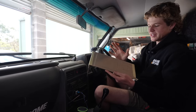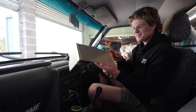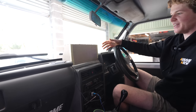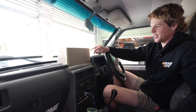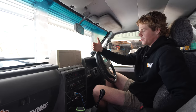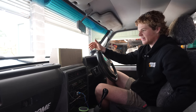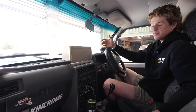So this is something I've come up with — my CAD design, or cardboard assisted design, as many of you would know I like to use. It's very basic, literally just going to be a box that fits on the dash, but it's got enough room to house my double-DIN head unit, as well as my JRP multi-gauge and room for a few rocker switches. It should be very easy to make — I'm probably just going to fold it up out of some aluminium and then carpet it so it blends in with the dash mat.